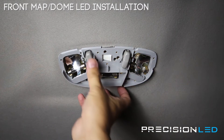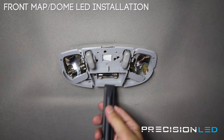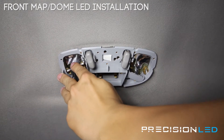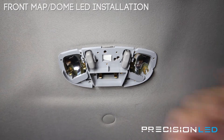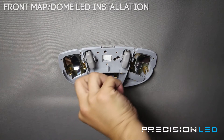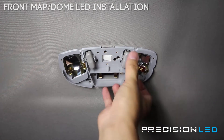These are festoon type bulbs and we're going to replace them with our LEDs. I just took the flat end and used it to pry and push them out. We're now replacing with our LEDs. You want to make sure that these clamps have enough grip, so you can use your fingers or a pair of pliers to squeeze them back together a little bit. When you remove the bulbs it kind of pushes them out and loosens them, so you're just tightening them back up. These LEDs go back into place — pretty simple.